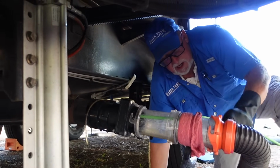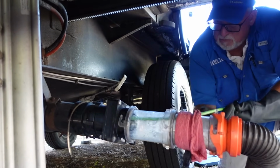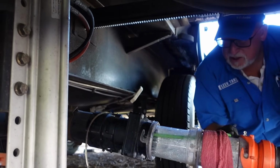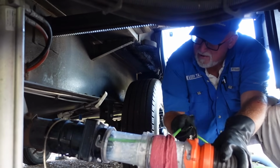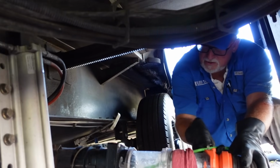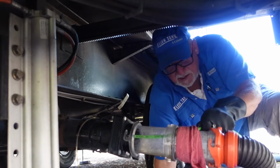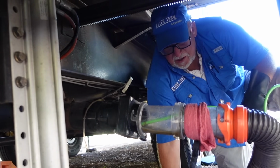When we're done here with the washing, we'll get into the rinsing part, and I'll show you a little contraption that I recommend every RVer have. Yeah, you can hear it up in there doing its job. So I'm just looking for a reduction here in 3 things. The color, we like it to be not quite so dark and brown. That tells me I'm getting it clean. The consistency, we don't want to see that kind of river of lava that we saw earlier. And then just less of what we call content. So more of a watery discharge than other stuff. But it's still coming out.